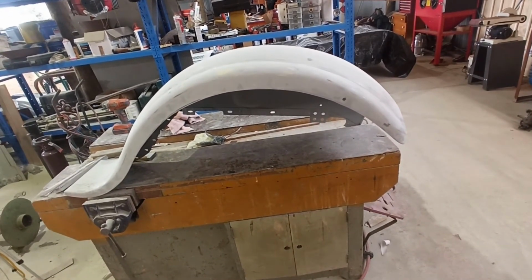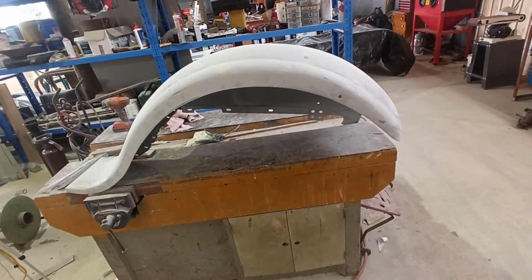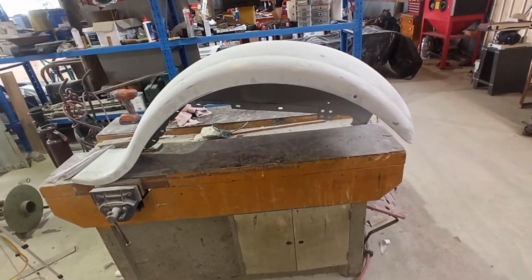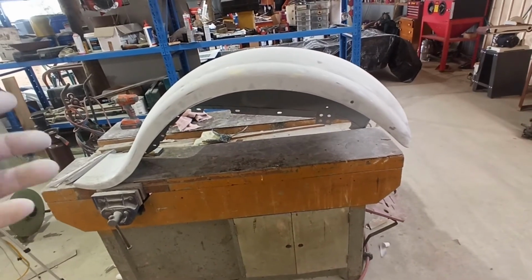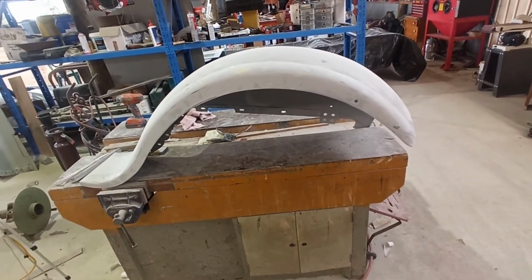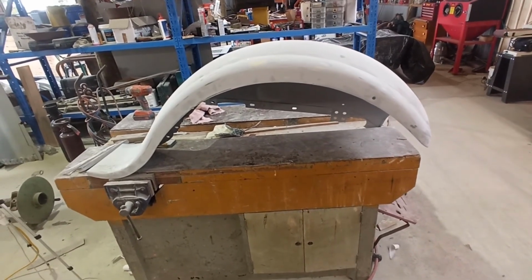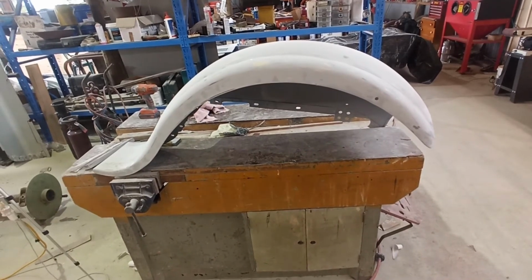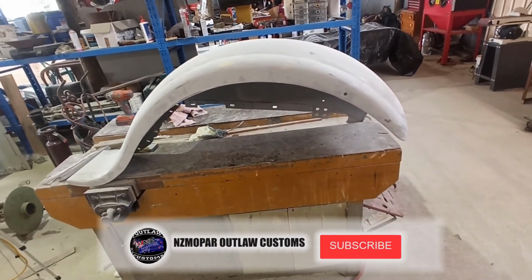And obviously get those rear fenders done. And then hopefully, it's today, Tuesday, maybe Thursday again, which is about the same time as when I painted these, or high-builded them last week. Maybe see if we can get them into high build again on Thursday. So that would work out nice, leave them a couple of days to harden up and block them out again. So that'll work quite nicely.